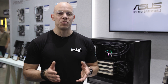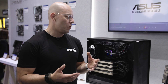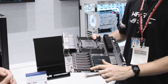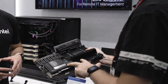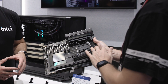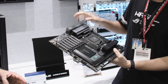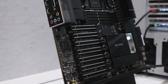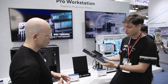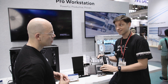There's one more thing to show at the Asus booth — we found a W790 Sage motherboard. This is for Sapphire Rapids and we're very excited to show it because it's brand new. So we have Sasha here to help. Really cool about this board: you've got seven PCIe Gen 5 slots and two extra Gen 5 SSD slots with four lanes each, plus another Gen 4 slot. So you get tons of PCIe Express lanes. Eight memory channels with one DIMM per channel — each DIMM is its own channel. Sixteen digital phases for the VRM. And this heatsink here is not for the VRM — it's for the Ethernet ports, because there's not one but two: a 10G Ethernet port plus an extra management port with its own chip for remote network management configuration. It even has integrated graphics so you can see output even with no graphics card plugged in. Crazy, over the top — and it's a workstation board, but you can overclock it, which is really unusual.